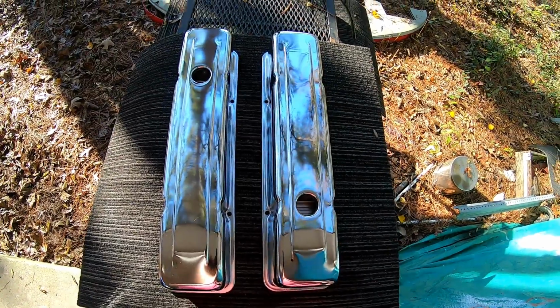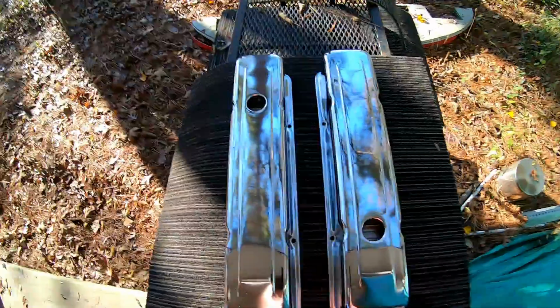Basically, if you want to do the valve adjustment with the engine running on a small block Chevy, you're either gonna come up with something ingenious to stop oil from getting all over the place, or you're gonna have a mess. This is something that people have been doing for years, just cutting up an old set of valve covers and using them to stop oil from going all over the place. There's people that have actually made a business on making products like this, and more power to them. They're selling them at a really good cost. I think you can pick up a set for about 50 bucks.